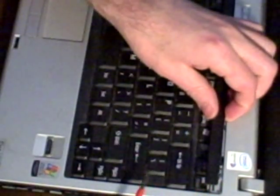You start by getting out the top cover that hides the screws for the keyboard. There are two little slots for prying with your screwdriver, and after that if you just sort of pull it forward towards the keyboard, it comes right out. Then we have two keyboard screws, so I'm using a small electronic screwdriver going after these screws here — there's one, there's two — and I can usually do this pretty quickly even though I have shaky hands.